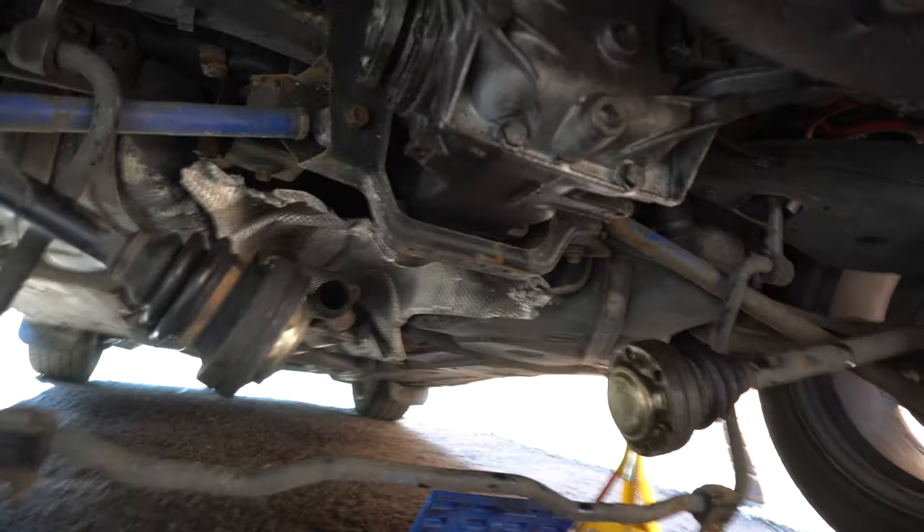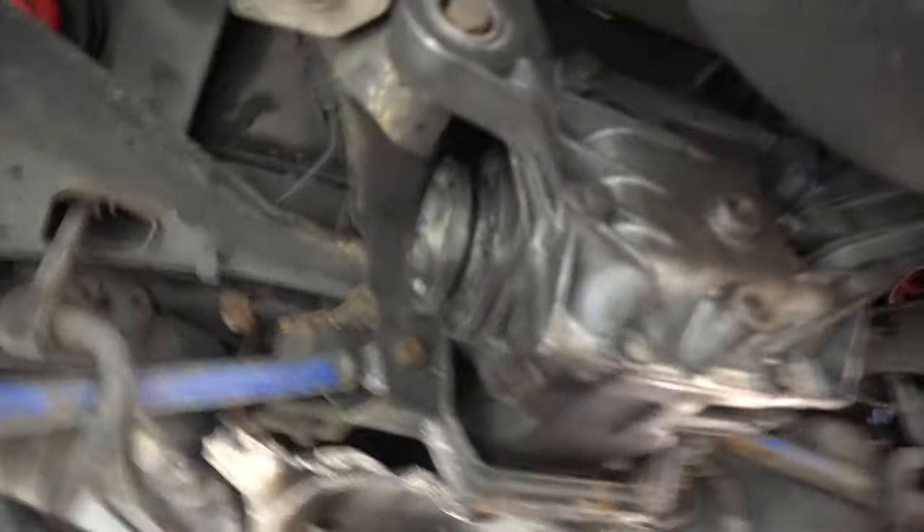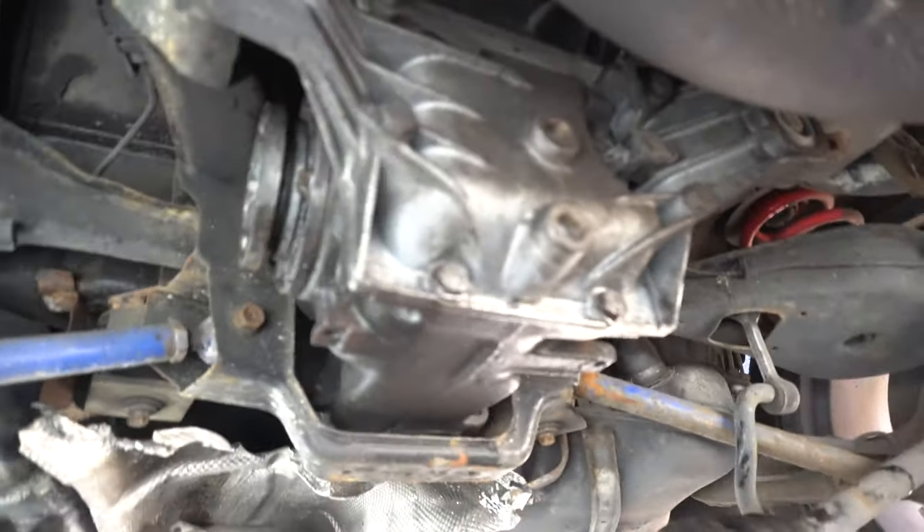The reason taking the diff out can be tricky with those axle carrier bolts and prop shaft bolts is because they want to spin. I'm pretty lucky - I've had my car apart a few times and everything in there is fairly well greased up so it wasn't too hard to remove. To remove the prop, you either want to get a bar and try to get it in between the prop universal joint and hold it, or you need somebody in the car who can stand on the foot brake, use the handbrake, put the car in gear, and intermittently let off to allow you to rotate the wheels and turn the prop to get to all the bolts. I've now got it all off - just the three diff bolts left.